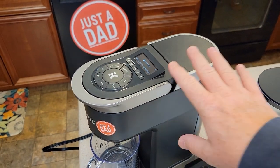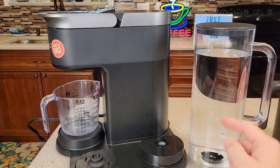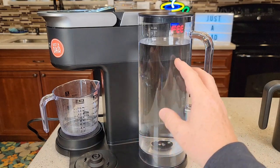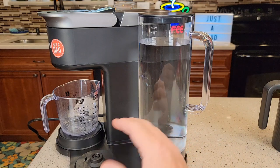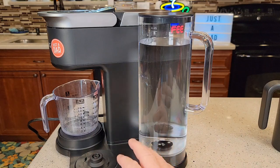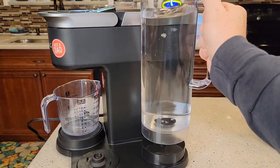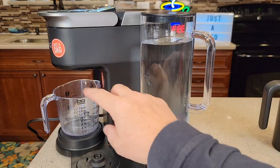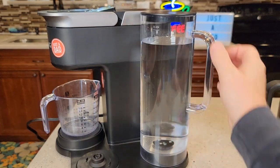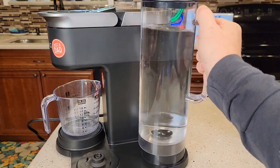So I plugged it in. It powers up right away, but there's a trick — I want to show you a trick of priming the pump. Before you press the brew button, fill your water reservoir all the way up and we're going to put it on and off several times. Your thermostat may have tripped because you accidentally ran it dry — say you removed the water reservoir while it was brewing, or the add water light didn't come on and your machine ran dry, or even during a descale sometimes they overheat. This is a really nice trick of priming the pump — take it on and off, about 10 times. What that's going to do is push some water through the machine and get it into that heating element so that when you turn the machine on, that heating element isn't dry. That heating element needs water in it, and it kind of primes the pump.